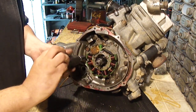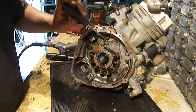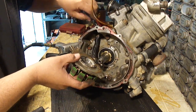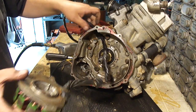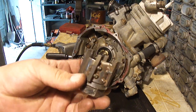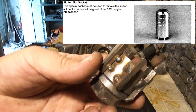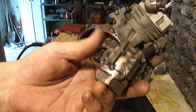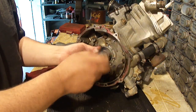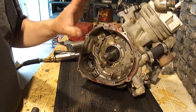There's three screws in here. Let me just get in here and kind of pry on this thing just a little bit — pop right out. Push this grommet through and feed all the wires through. This is a tool that I made to get that nut off. You can buy this, you don't have to make one, but if you do want to make one it's quarter-inch keystock welded to a socket. These are left-hand threads, so tighten it to loosen it.